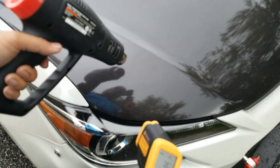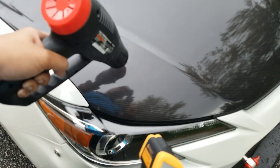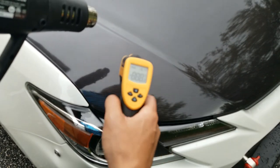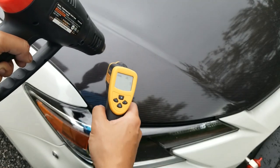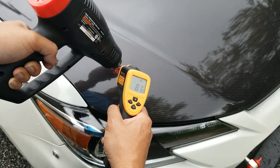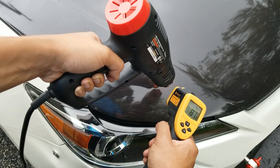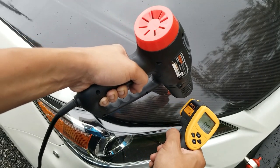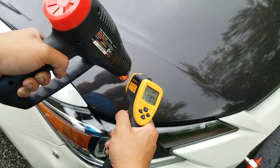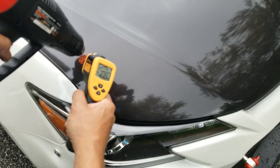Now I'm going to turn on my heat gun on high. From my experience I know already that I'm going to have to hold it right about here to get it to be 90 degrees. Just kind of go back and forth slowly — I want to get it up to 90 degrees. It's going to be a little bit of a slow process, but you want to make sure that you do it. Otherwise you're going to be really unhappy when wintertime comes around and the vinyl starts to pull away.